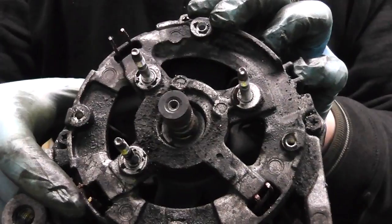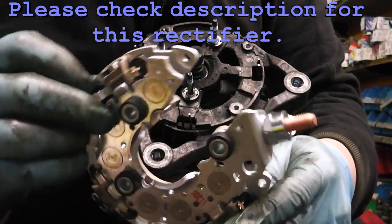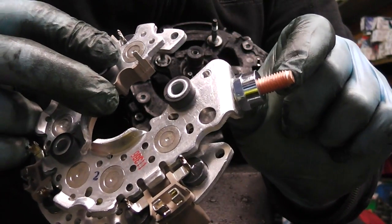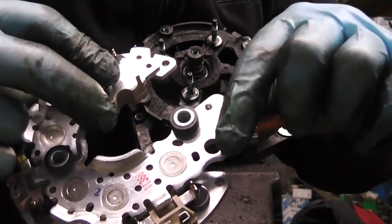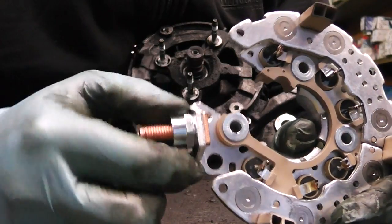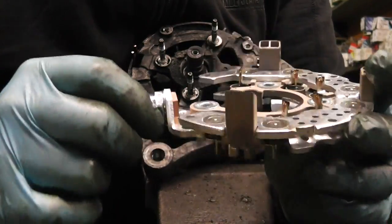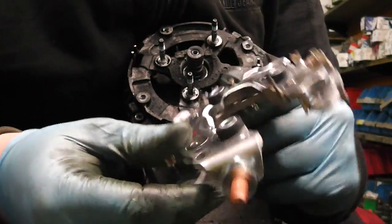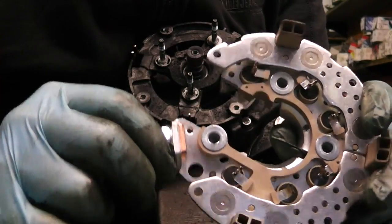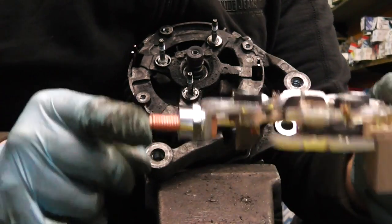It's time to fit the new rectifier. These rectifiers are all the same bar one basic difference: this stud and tip could be short or long, or it could be M6, or in some of them the hole comes from the top. It doesn't matter which one you buy — all it takes is to unscrew that nut, knock the copper piece out, get the old one from the old rectifier and put it back in. They are all interchangeable because the bore inside is the same M8 size in all of them.